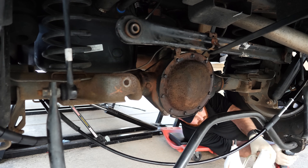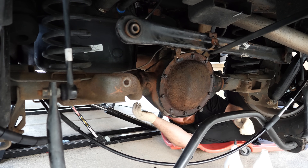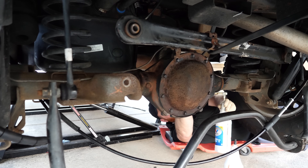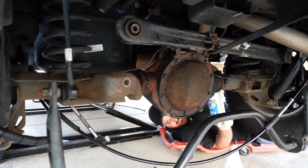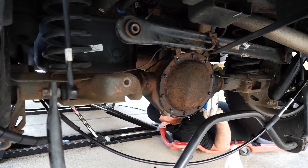Now I don't know what to put in here as far as gear oil goes. I got 75-90, I think that's the correct weight. But as far as the additives go, it is a G80 diff. Just Googling random forum posts, people say this doesn't take a limited slip additive, but it has clutches in it so I would think that it would. However, I haven't been able to find gear oil that doesn't say it contains a limited slip additive — this is the cheapest I could find, Valvoline, and even that says it contains a little bit of limited slip additive. So it's getting it regardless. I'm pretty sure it's supposed to take it because I know GM sells the little black bottles specifically for their diffs — this should do the same thing.